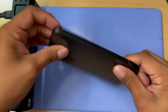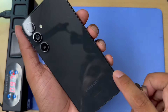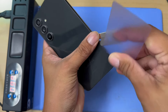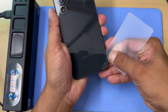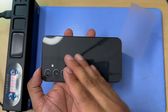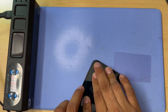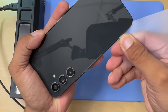I think this is warm enough. Let me grab my phone and razor blade and start digging in between the frame and the glass just to create a very small gap so I can squeeze in my playing card. After squeezing my playing card in, I can set the razor blade aside and keep going with the playing card. Remember, don't let this get cold because the glue is just going to stick back and it won't be easy to remove. Keep warming it up so it comes out easy and you don't break it.